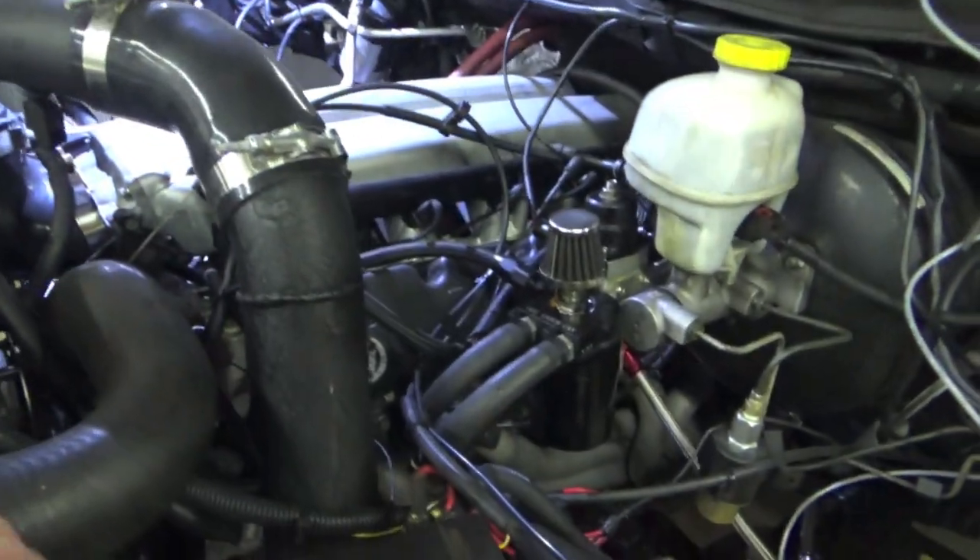We're having a little issue with crankcase pressure because my turbo leaks a little bit due to all the crankcase pressure. My catch can breather is just not big enough for the amount of boost and power and engine size of this 505 cubic inch Viper V10. This little filter right here is just not cutting it anymore. If you blow in the actual drain tube of the turbo there's a lot of pressure in there. So today we're going to be hooking up the exhaust evacuation kit, mounting it in the down pipe of my turbo. Hopefully this works — I've never used this before, I heard about it from a friend and it sounded sweet so I had to try it.